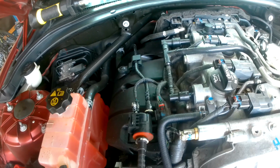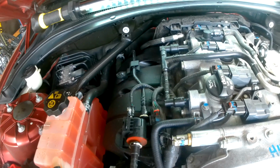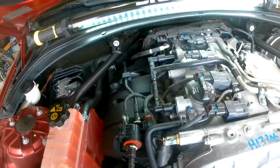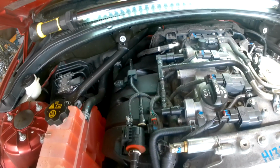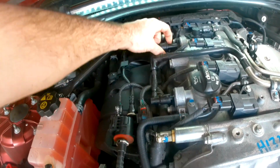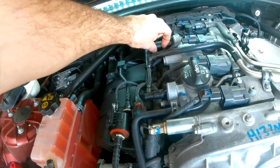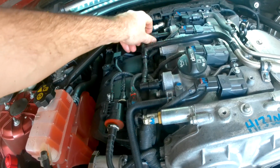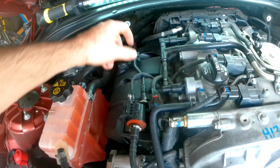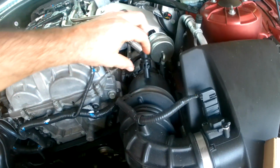Now the other thing I want to point out is these hoses have two types of connections. You can buy them in two different ways. I prefer the style that is not on this car. This car has the more difficult fuel line style connectors where you've got to slip a special tool underneath the edge of here to remove the clips from the inside. You push in on the hose and then you pull out and it will come off, and that works for both of these.